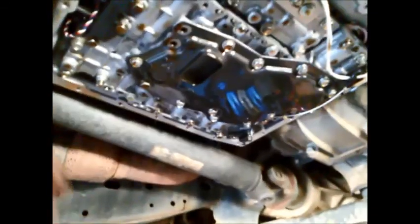So we're going to take the filter off and do the service. The oil is pretty dark and contaminated — like the owner mentioned, he's never serviced it, only dealership services, and they don't actually do any servicing on these transmissions. These transmissions are very similar to those in the Kias and Hyundais, and you can see the filter actually arrived in Hyundai packaging. I believe there are three types of filters — one is plastic and the two others are metal. Just make sure you compare the new filter with the old one before you put it on.